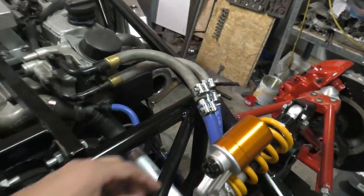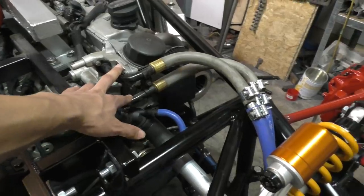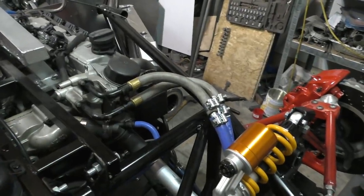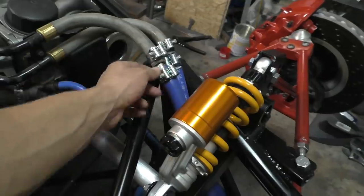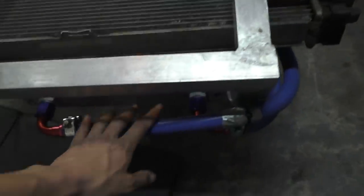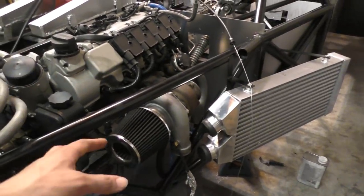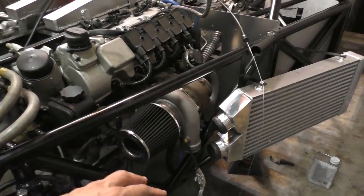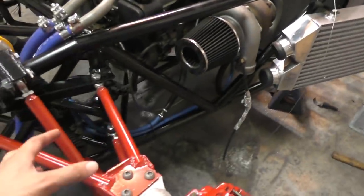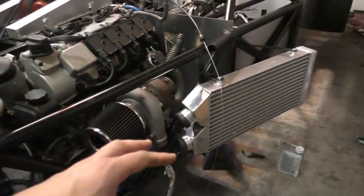For the engine oil cooler, I had to connect two lines — these are the lines that go to the factory oil cooler on the E55, which I had previously modified with fittings to run an aftermarket oil cooler. All I had to do this time was cut the hose off and connect longer lines that run all the way to the oil cooler at the front. Systems still left include the turbo drain lines — I need to add a scavenging pump to return drained oil from the turbos to the engine — and then the fuel system, braking system, clutch line, and the induction system for the turbos.